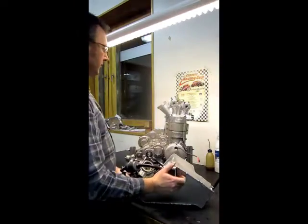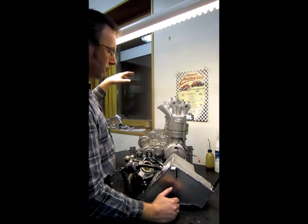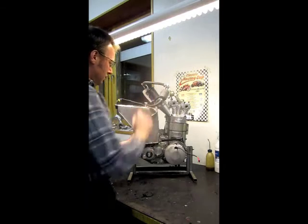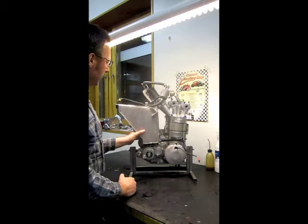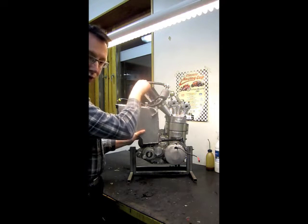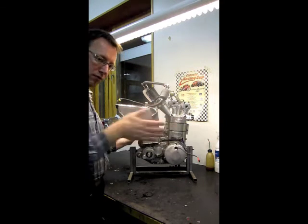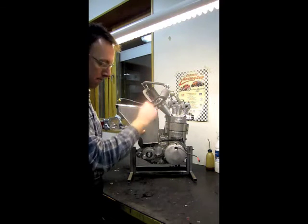When raising up the inlet as much as this, you will not have the possibility to have fuel here in the normal way. So I had to make a separate fuel tank, like this. There it is — the fuel pump is down here. And this is a throttle body from the Ducati 1098. It is very large and it is ovally shaped. The oval shape is good for the transition between the throttle body and the inlet port down to the valves — it will be very smooth, not like a big Y going down, but very slim.